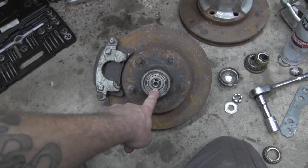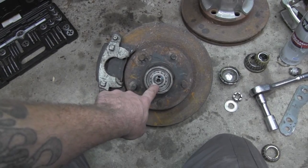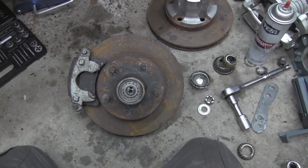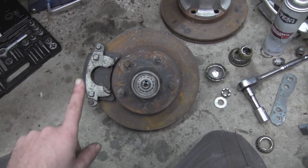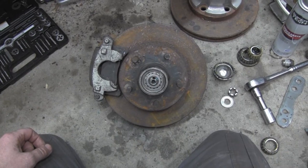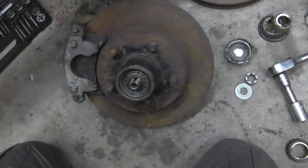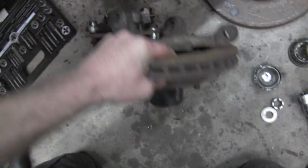And then that's a set 2 bearing with the spacer sleeve, just like the old hub setup took, and then a set 30 bearing on the inside with the shoulder chamfered on it so it fits tight against the spindle, which actually was very easy to do with a Dremel tool after I butchered the hell out of it with the grinder first, because I was in a hurry. I'll show you that in a second, but at any rate, let's get this flipped over and I'll show you what else I'm working with.